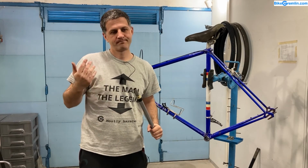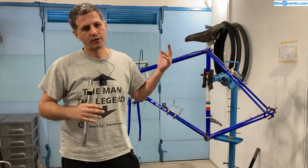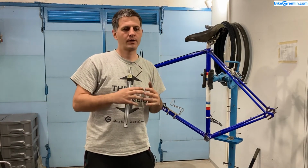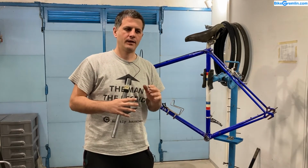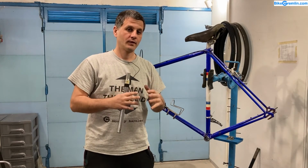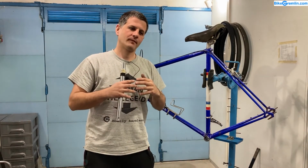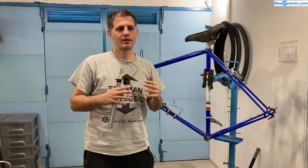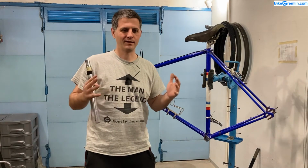when it fails, it does not give any signs that are visible on the outside very often. It just gets weaker and weaker. There's delamination in the fibers and other problems. And that's one problem. You will not see it when it starts to break. And the other problem is when it breaks, the failure is, like I say, catastrophic and complete and sudden.